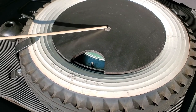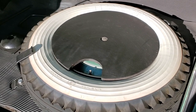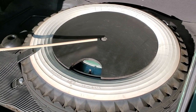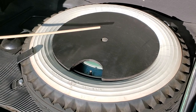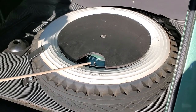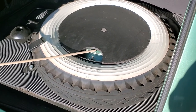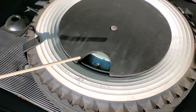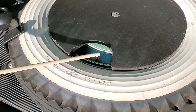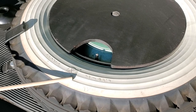Down under here, because this is sunk in, there's actually about a three-by-three square on the back of plywood that's fastened to the back of this main piece of plywood. It's a half inch thick, and that provides the recess for the carriage bolt. Right here you'll notice how the tire is mounted — this is so you can actually fill the tire while it's in the trunk. It has a cutout that goes as high as the little stripes on your wheel. You can scale off the size of your wheel. This is a 650-16 tire.